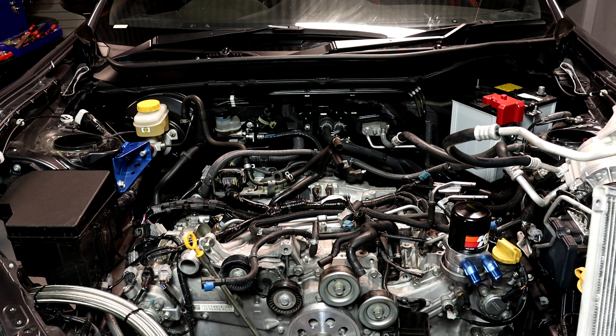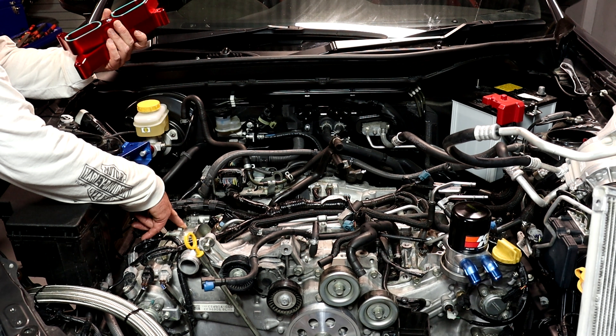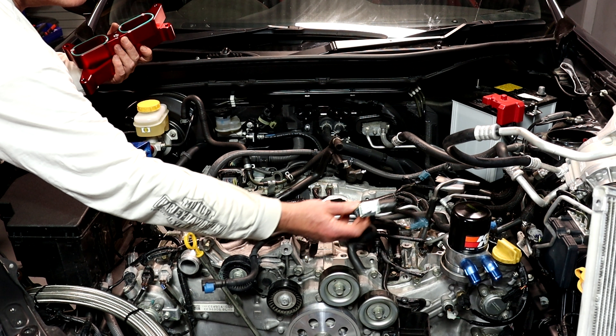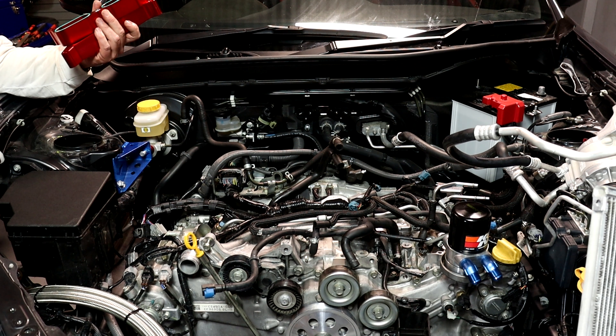Quick recap: I've inspected both blocks for fitment and flatness, done a quick test on the o-rings to ascertain whether they'll handle the heat, and everything seems fine. I've cleaned and degreased both ports and mating surfaces on both cylinder heads and the inlet manifold, and had a look inside to make sure nothing's got in that shouldn't. Looking back at the disassembly video, this little piece here is the nut and everything that attaches to the manifold — when you undo that one bolt you get this whole assembly. We're pretty much ready to start the install.